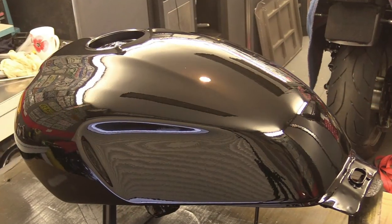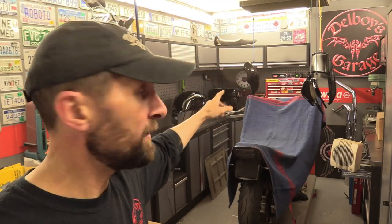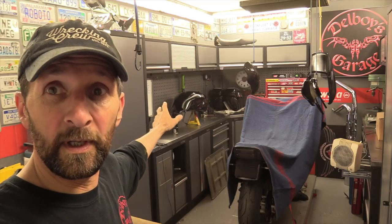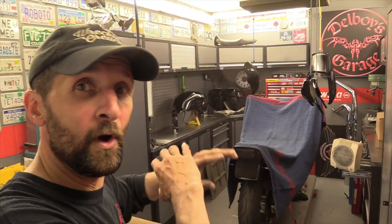Having seen the tank with that lovely liquid gloss finish, that'll dry satin because it's satin paint. The tail unit's already dry and satin, but although that'll dry satin, I think we're gonna clear coat it, so it looks like that lovely rich liquid gloss. Now I've put one thick wet coat over the whole lot. It's only a base coat, you don't need to make six fat coats, because it's going underneath the clear coat, the lacquer itself at the end.